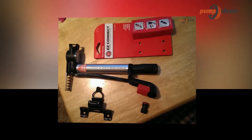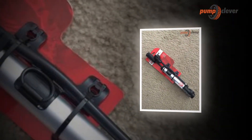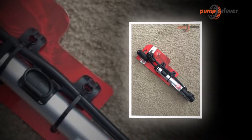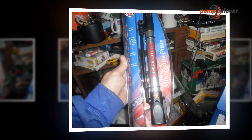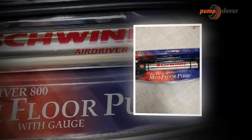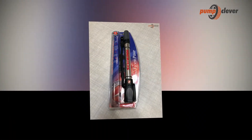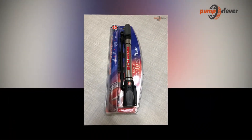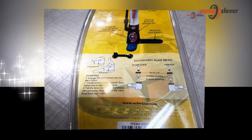A metal foot peg will have a longer life than a plastic one. A large volume foot pump, possibly equipped with an additional air tank for tubeless tires, reliable, stable, and equipped with a precise manometer, is permanently stored in the workshop or the car. A small hand pump completes it for repairs in case of a puncture on the ground. Competitors will prefer a CO2 pump in the field — faster, but the cartridges are for single use. In the workshop, a high pressure pump also ensures precise adjustment of air suspensions. An essential foot pump allows you to inflate your tires efficiently and without running out.